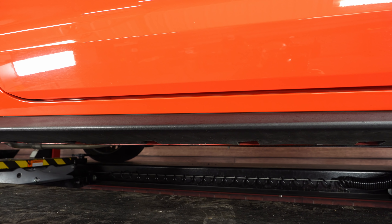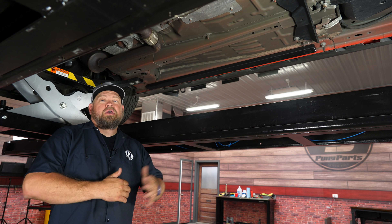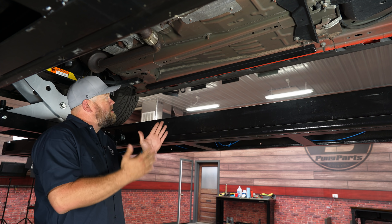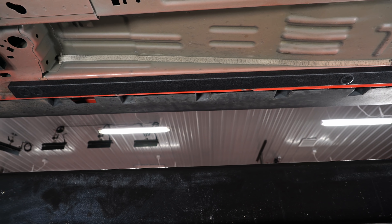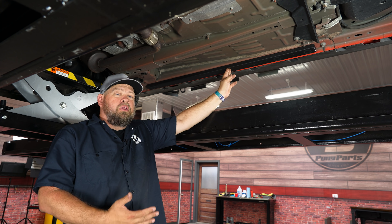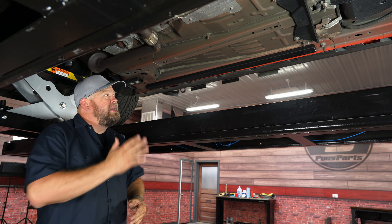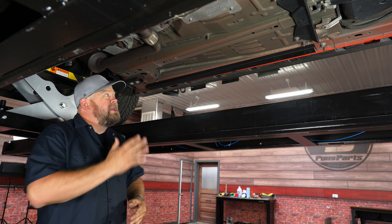For the side profile, you can see why they're called low profile. If you remember the original style ones, they actually stuck down below the pinch weld. These are even with it front to back — you really can't even see them. The Steeda Ultralight low profile full length jacking rails are very easy to install. The benefit is if you're jacking the car up anywhere from the side, you don't have to worry about the pinch weld — just put it right on the jacking rail and jack it up. You can also go in the middle and lift the whole side at one time, which saves a lot of time if you're at the track.